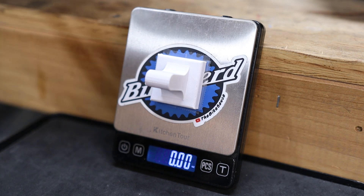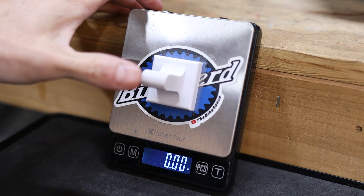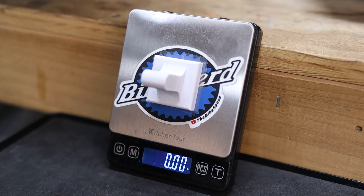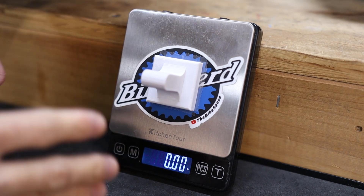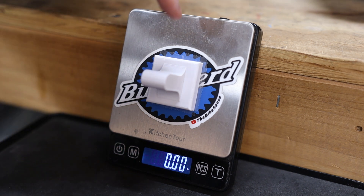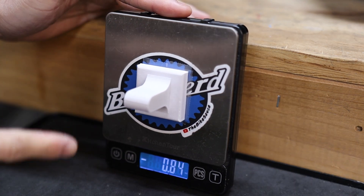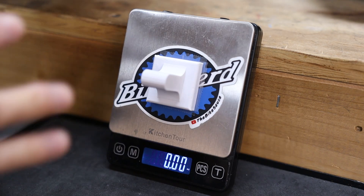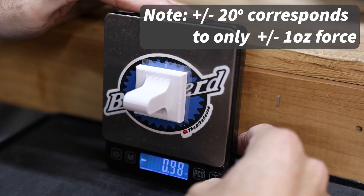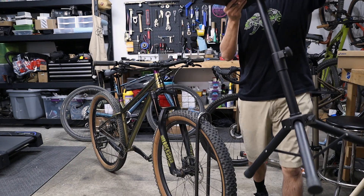What I have here is my scale that I use to weigh all my bike parts, and I've 3D-printed a little proxy for a finger which I'm going to use to actually push all the brake levers. So basically if I just push this down I can measure the amount of force required to depress each brake lever. Now for anybody who's going to criticize the pseudoscience here — yes, this is basically just a digital kitchen scale and the core technology is just a load cell mounted underneath inside the housing. That means orientation actually matters, so if I tilt the scale to a different angle you can see I get a non-zero measurement. So this is of course not perfect science, and I've got to keep the scale pretty much vertical, then zero it out right before I depress each brake lever. Real science is happening.